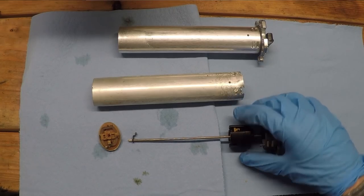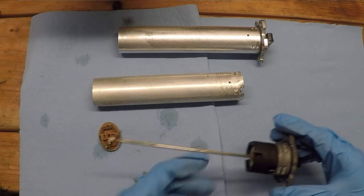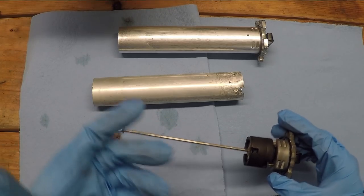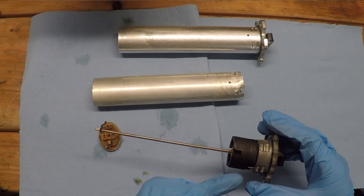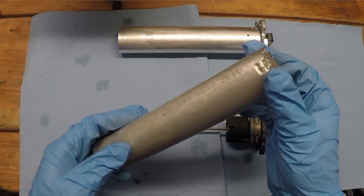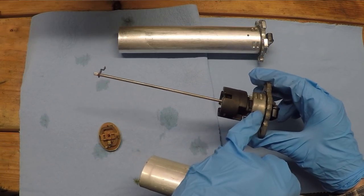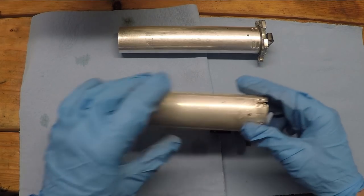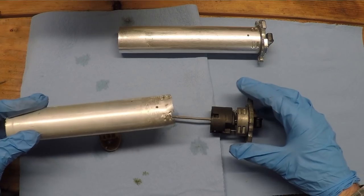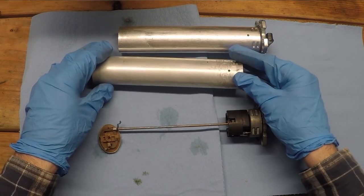With the old one over here on the bench, we can see all the components that make it up. I obviously took this thing apart because I originally tried to see if I could fix it. And while I may have been able to do that, I ultimately caused a lot of damage — because first of all, to even get inside of this, you have this aluminum sleeve which is very thin. You have to break these little indentions that affix it to the top of the sending unit, and once that's done, it's pretty well mangled. Getting this back up and re-tightened down — that's your first obstacle, which I wasn't able to get past.